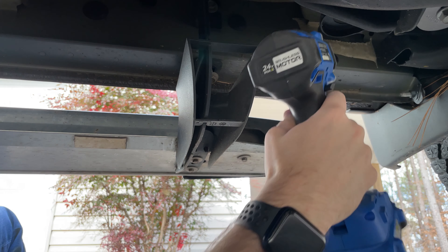To do the wiring, we've got to unhook the battery and then start using the items in the control module box. To get the wires into the truck for the control module, you have to drill a hole through this plug here. The instructions say to take it out, but it's really stuck in there and I didn't want to mess up that seal, so I just drilled the hole right where it's at — we'll silicone that to plug the hole and make sure it's sealed. The module is screwed in back here behind this panel, with wires hooked up to it. These wires coming through are for the battery and both of the motors. I've got the wires spooled in and running up the back behind everything so it doesn't interfere with the brake pedal or gas pedal. Once I put the carpet down and get the floor mat back in, you won't really notice anything is under here.